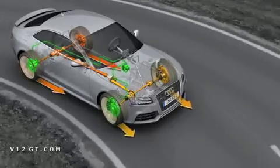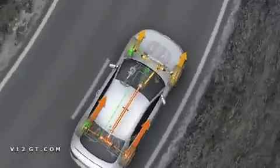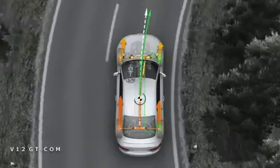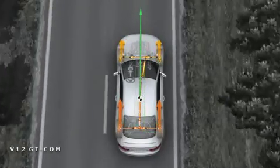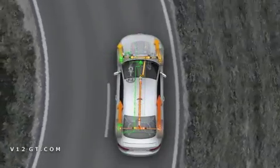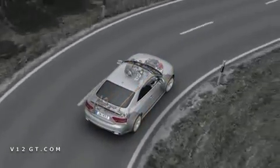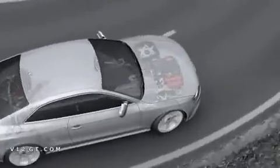The dynamic drive force distribution allows excellent exploitation of the traction potential, good track stability, and outstanding agility. The torque vectoring system was developed by Audi to act before the wheels start to spin, reducing undesirable effects. The combination of Quattro drive system with crown gear differential and torque vectoring gives the Audi RS5 outstandingly precise control right up to the car's handling limits.